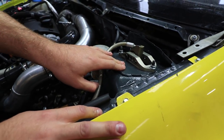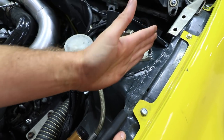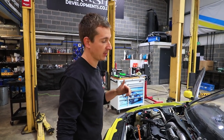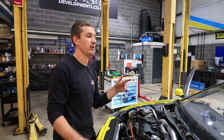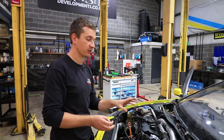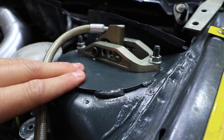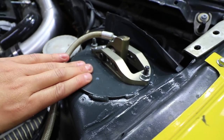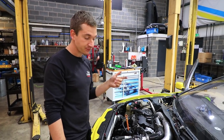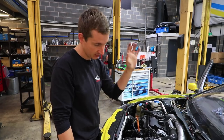This is the Toledo touring car top mount. What we had to do was chop the top off, weld the plate back on, and put this adjustable top on. How it works on the setup sheets: you set all the camber and the toe at the bottom, and this is just there to get your baseline. If you want two to three, three to four, four to five, five to six degrees, you sort of set up on those. We had to do things a little differently because not all the parts were available, so we had to make our own graduated adjustment. We didn't have any jigs at all, so where we put these had to be where we thought they could go. If you're modifying top mounts, you want to put it as far back as you can — that gets you your caster.